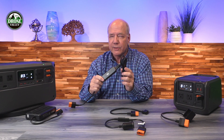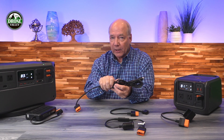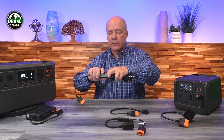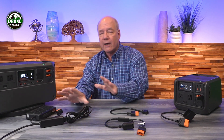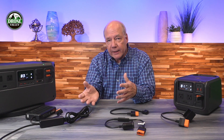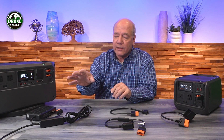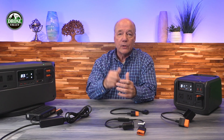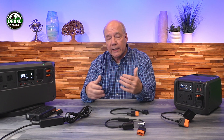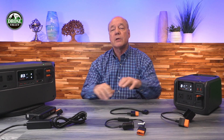The big brick in the center of the DC Car Kit regulates the 12 volts DC and tells the power station you're plugging in a 12-volt charging adapter, so it knows to accept that current and pass it on to the batteries. One important tip: this will draw current from your car battery, so if you're camping and plug it in while the car is off, you may have trouble starting your car. I only use it while driving, so the alternator is generating DC and I'm not draining the battery.